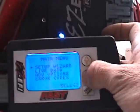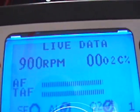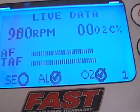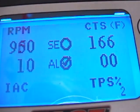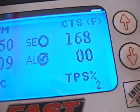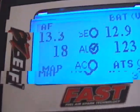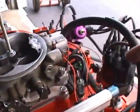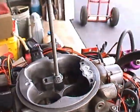Here's my handheld — let me go to live data. You can see everything: RPM, target air/fuel ratio, and actual air/fuel ratio. It's learning right now, constantly learning. It shows my idle air control motor, RPM, coolant temp sensor, throttle position sensors at zero because I'm not giving it any gas. Air/fuel, battery, MAP — it all looks good. Air temp sensor is reading a little high because I've got it mounted in one of the intake runners.